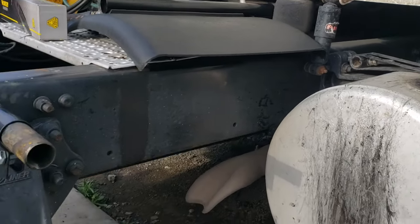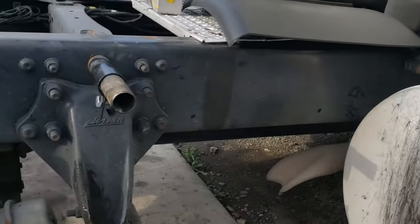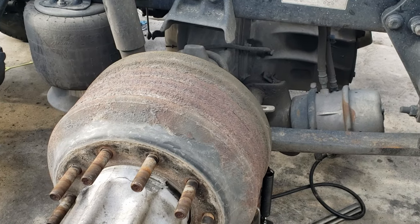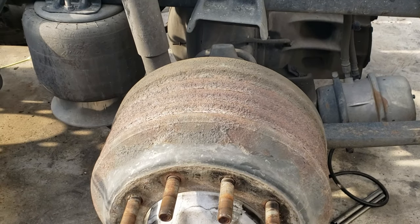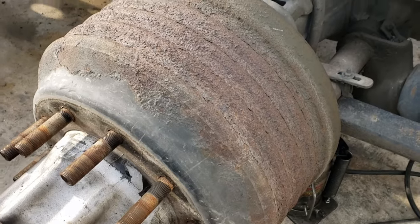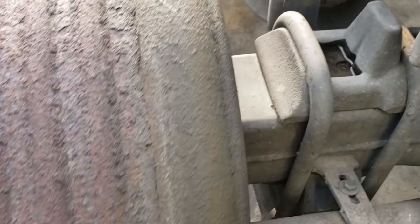Release your brakes on the cab. But before you release it, make sure the air tanks are full. So once you release your air brakes, remove the tires. We already removed them. So now you want to remove your drum, but most likely it will not come off